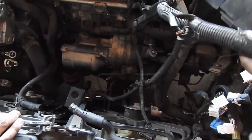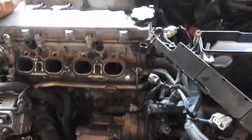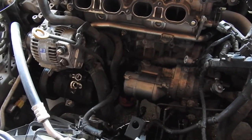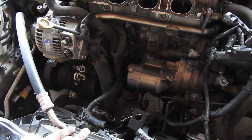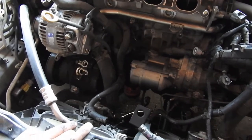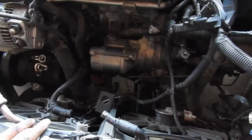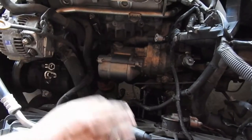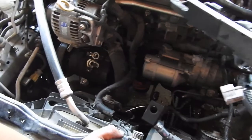Are you guys saying what size of nuts you need to take off? No, because it's pretty common for most of these cars. But some people don't know. As long as you got everything, a deep socket from a 10 mil, 12 mil, 14 mil, 17 and 19 and 21, you're good. That's all you need. And, of course, wrenches whenever you can't get a socket in there. And when you get really mad, a hammer. For the most part, you just need some basic tools. And that's it.